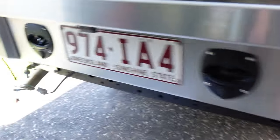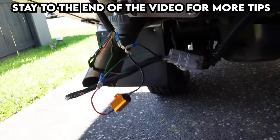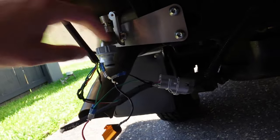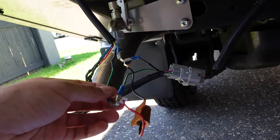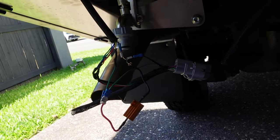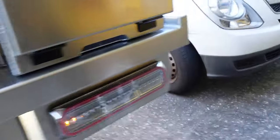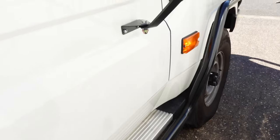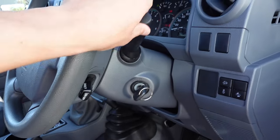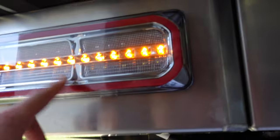I'm going to show you this wiring mess I've got down here and explain it so you can understand what's going on. Basically you want to get the ground wire and the positive wire — the wire that goes to your indicator — and you need to trick the system into thinking it has an additional load. The left side is its own circuit and the right side is its own circuit. You can see the right side is flashing like crazy, but the left side is behaving normally because it's been tricked into thinking it has that extra load.